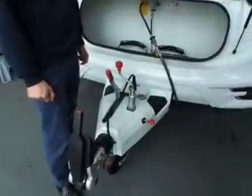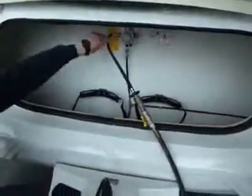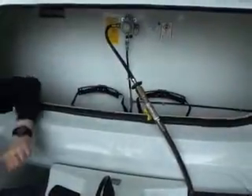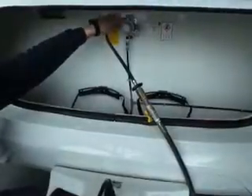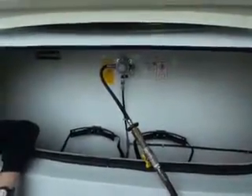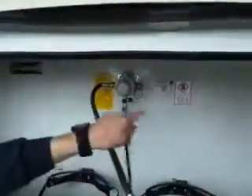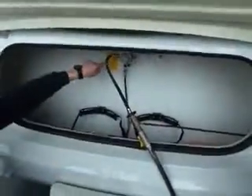The gas locker has a dual control, so you can have two cylinders connected. Whichever side the dial points to is where the gas is coming from. This is your pigtail — you need to get one that fits your particular gas. There's an indicator up there: green means there's gas pressure; red means it's about to run out.